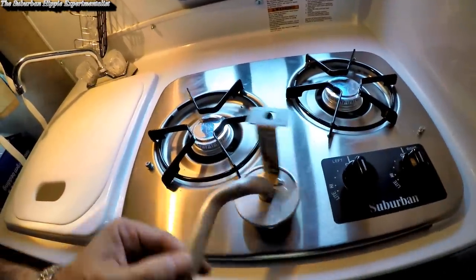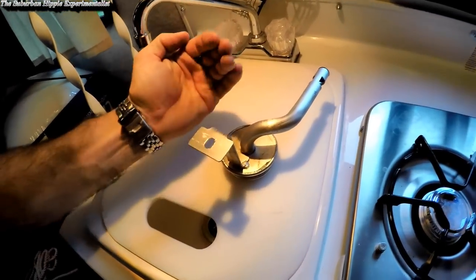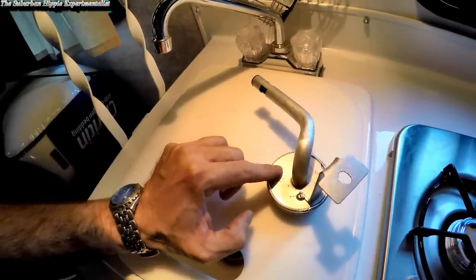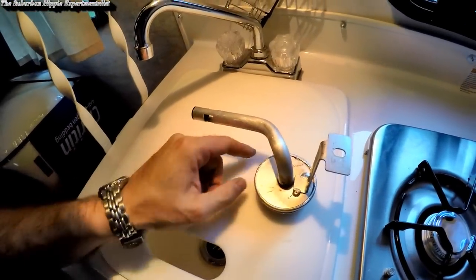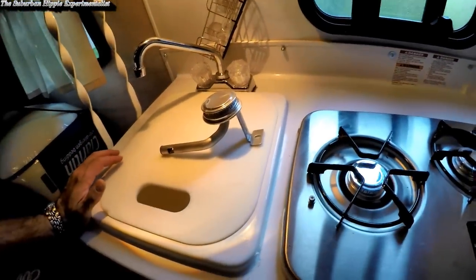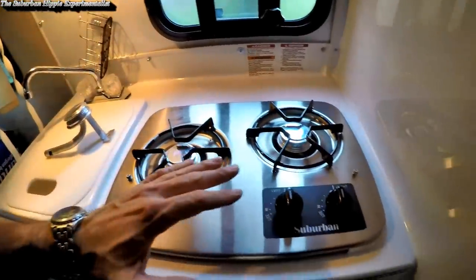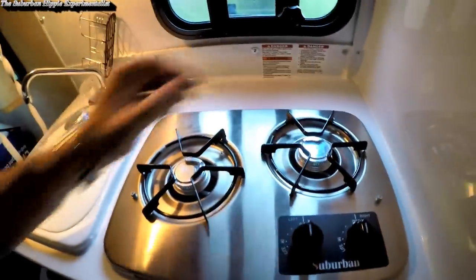Here's the defect — let me put it over here in the light so you can take a look. As you look around you can see a nice pronounced lip where that burner's folded over the bottom piece. When you get right here, you can see it's not folded properly — you don't see a lip that comes over and grabs this part. When you light the burner, this would leak down and you'd get a little blue flame under there. I found that unacceptable. I contacted Scamp, they transferred me to the owner, he apologized and sent one out right away. They also sent me a valve, which I did not need. I unscrewed the two screws, took it apart, and replaced it.